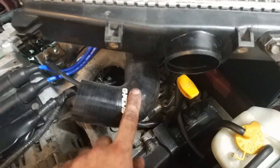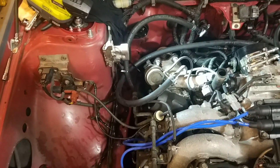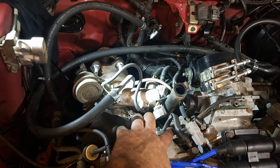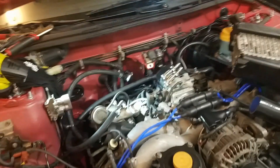I'll install the intercooler, and then tomorrow I probably have about an hour and a half of work left — just the intake and installing the O2 sensors, and that's pretty much it. When I say the intake, it includes getting all those fittings in — if I just had to get the filter on that would take five minutes, but it's getting all those bends in using the brass nipples. I see like another hour and a half and then we can probably start it up, but I'm calling it quits for the night.